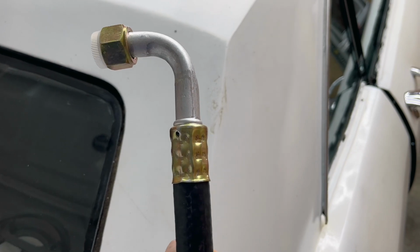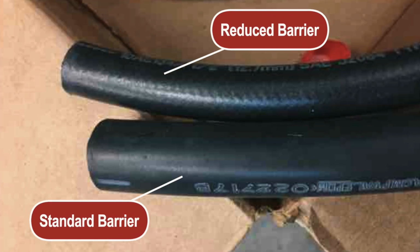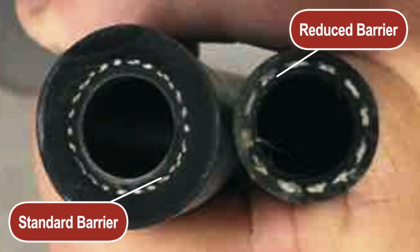If you're going to take your heater hose to the same place that would crimp an AC fitting, make sure they use this style crimp instead of this style crimp. I know the second one looks way better, I'm aware, but it doesn't work as well when you need to do slim fittings like this. Heater hose has a much thinner wall than your average AC line. That's the secret. These are actually the slim AC fittings, slim AC hose that has specific fittings that crimp onto them. That right there is the reason you can't take a standard AC fitting and crimp a heater hose to it.